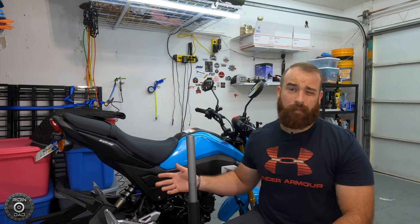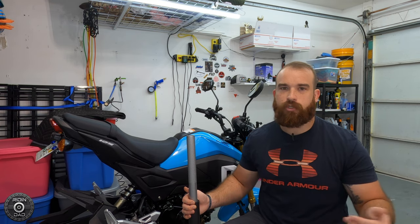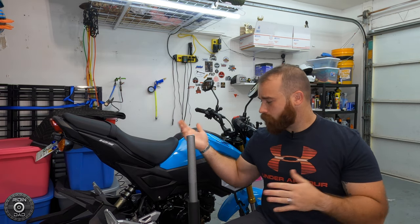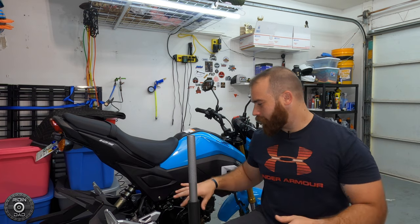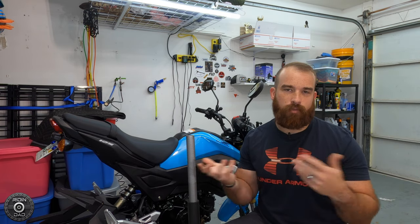And then you have 2 options. You can either drain all the oil out before doing this, or what I do, because I'm gonna have to drain the oil in like 2 weeks when I do a different install anyway. So what I do is just tip it over. I get my moving blanket, tip the whole thing over on its side. This is a super lightweight bike. I probably weigh more than this bike. Just tip it over so the oil doesn't leak out. And then when it's on its side, none of the oil will come out. You'll just have a little bit of that residue over your parts. So, all right, let's flip her over. I'll bring you guys closer and we'll explain what I did for this 6-disc install.